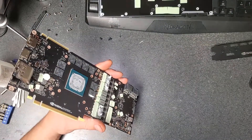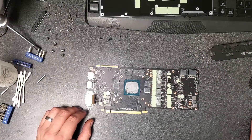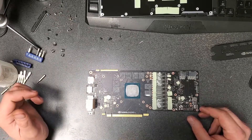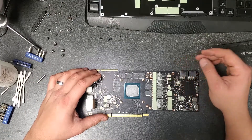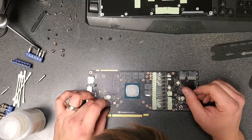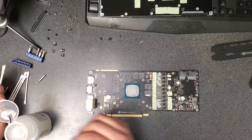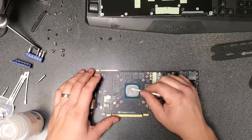Here's the massive cooler set aside. There's the thermal paste on the GPU — I've never seen it applied that way, but this is the first Founders Edition card I've ever taken apart. We're going to clean the thermal compound off the SOC; I believe it's a TU-104 of some sort. We'll clean it up, apply new compound, put it back together, and I'll show you the reassembly process in just a moment.